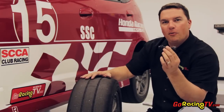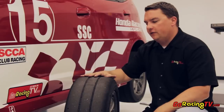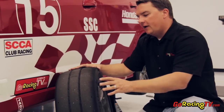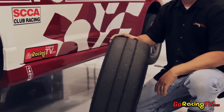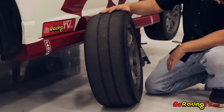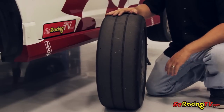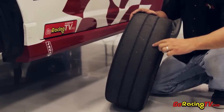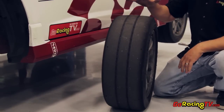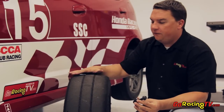This little item right here is called the camber bolt, and this is what holds the strut to the knuckle of the actual vehicle. What this little bolt does — it allows you to adjust the static setting for the camber. Camber is basically the alignment of the tire inward or outward. If the top of the tire is leaning inside, that's called negative camber. If it's leaning outside, that's positive camber. Adding a little bit of negative camber helps so as the vehicle goes through the corner and the car starts to roll over, in the middle of the corner you want the tire pretty much flat to the surface — using the whole contact patch. If you have positive camber in a corner, you're only getting a portion of the tire, you'll have uneven tire wear, and you won't have the adhesion you want. So we're going to set this car up with as much negative camber as we can get, so that as we go through the corner and it rolls over a little bit, we get a nice flat surface on the roadway.